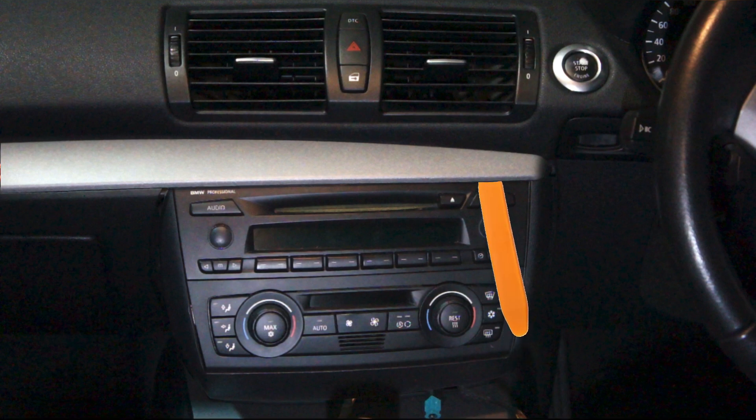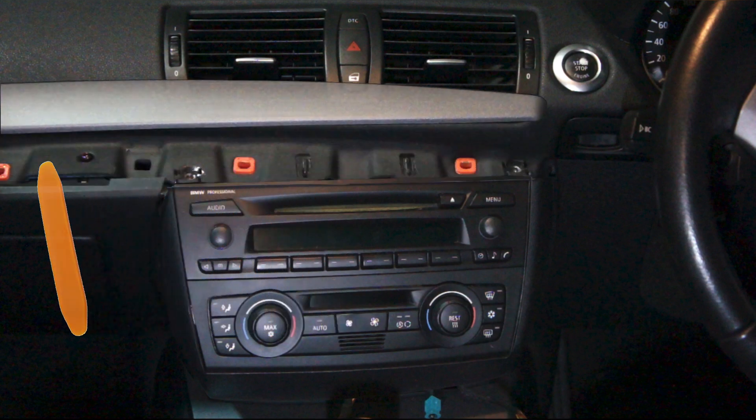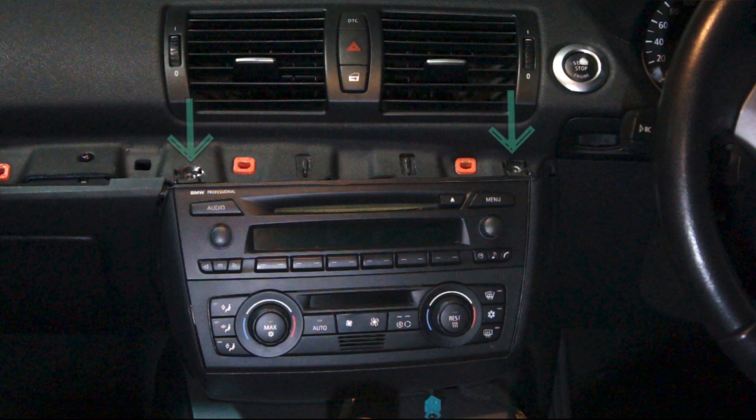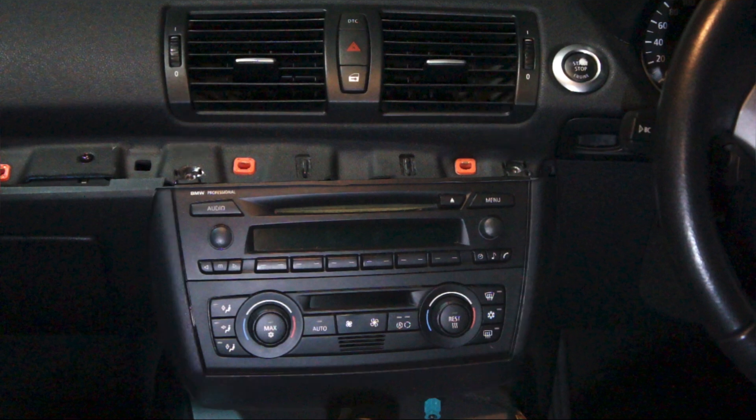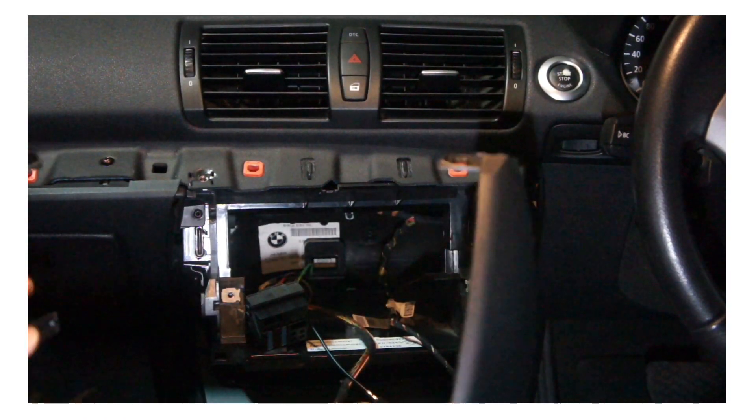These clips are very tiny and there's no way to glue them back together if you break them. So in this alternative approach, if your One Series dashboard looks like the second photo, the first trim you remove is the dashboard top trim. Once removed, you'll see two T20 Torx screws — remove these. At this point, the only thing holding the side panel in place are the clips on either side, and all you need to do is pull it up gently. You can see the location of the clips on the side for your reference.